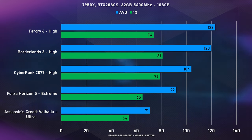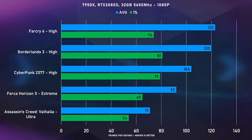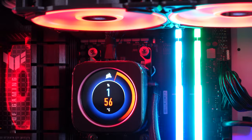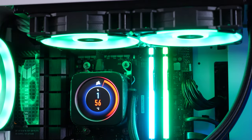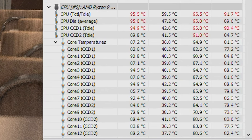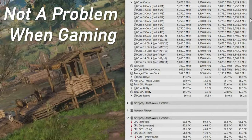Gaming also did well, but the limiting factor was my power supply — only 750 watts wasn't enough to run the 7950X paired with an RTX 3080, as both use way too much power. I ended up moving to my RTX 2080 Super which used a bit less power. Hopefully later on we can revisit that with something like a 4090. Cooling is also a bit of a problem: I paired it with a Corsair H100i Elite LCD 240mm AIO, which is a very good cooler but had a really hard time keeping up.